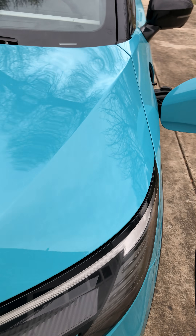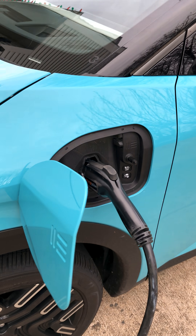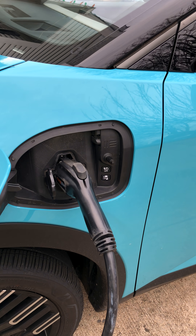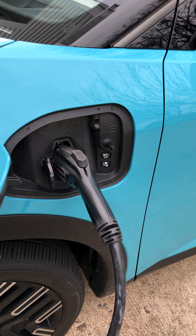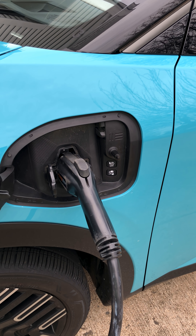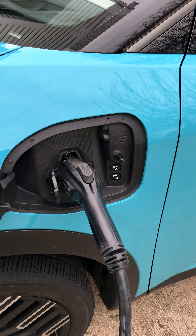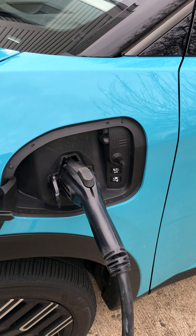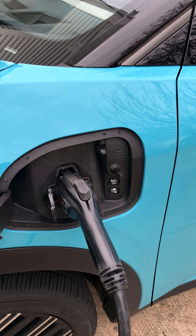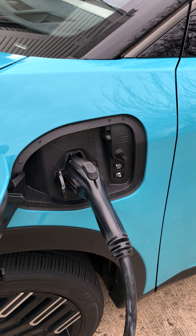On the driver's side, there's also an SAE J1772-style Level 2 AC charging port for home chargers that use that standard. It's important to note that this does not include a Combined Charging System port, so you cannot do DC fast charging from a CCS charger on this port. To do that, you need to use an adapter on the NACS port on the other side of the car.